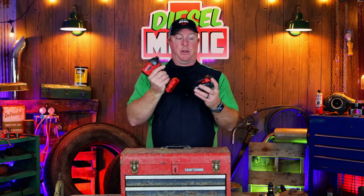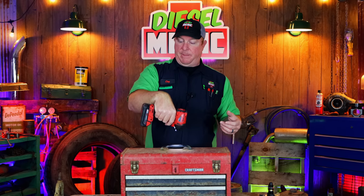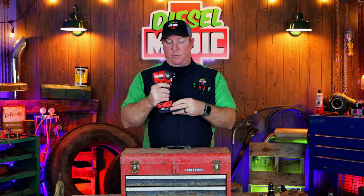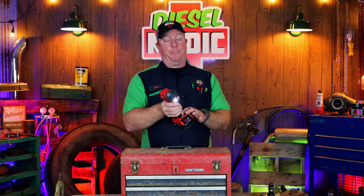Like I said in the intro, if you own an M18 Milwaukee, the chances are you've run into this issue as well. This is my quarter inch impact driver — it's happened to me on my half inch 2767 as well as my hammer drill. The drill runs fine until you turn it up and it gets a little vibration, the battery comes out, or it just comes out enough that it loses connectivity. You can restart the tool by simply bumping the battery. The issue is the battery will come forward just a little bit from the vibrations. I don't know if it's wearing out inside the tool or wearing out inside the battery — I just know that it happens. You'll be working with it and all of a sudden it'll stop working. So that's been my number one main complaint with the Milwaukee M18 platform.